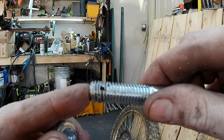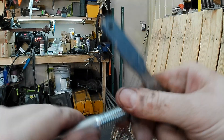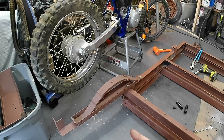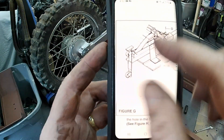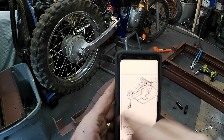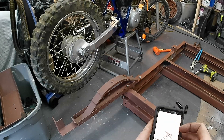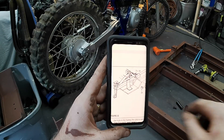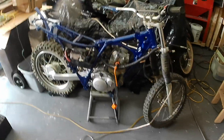It looks like it may have messed the threads up a little bit right there, so we're going to take a file and try to fix that. As long as it can spin past and I can get my cotter pin through, that should be good. I was trying to determine whether the spring went this way or flipped around - this is the way it goes. You can see in the manual that we've got where it holds the wheels on the back, and the curved end is near that. We just need to put a couple bolts in to hold that in place, then it'll be ready to put the axle on. I'll go ahead and put these wheels together and this fender piece. We're getting close to it being ready to use and take to Iron Mountain to haul our dirt bikes. More to come - thanks for watching.